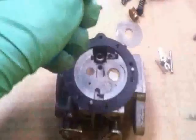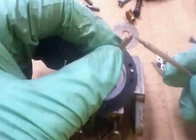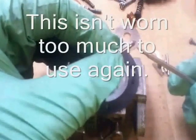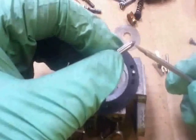We'll have a look a bit more closely. When you look at a metering valve, look at the end of that valve — it's this valve which blocks off the fuel, allows the fuel to come in, then blocks it off again. When it gets to a point where it looks like this, you can see there's been some wear on the end of the metering valve itself. A lot of people — and I'm sure the manufacturer would recommend — that you change it at this stage. I personally have put them back in many a times looking like this and they've been absolutely fine. In fact, I am going to put this one back and I'm going to prove it will be fine by trying it.